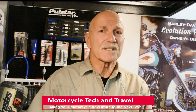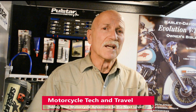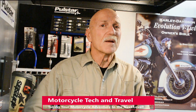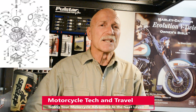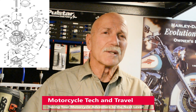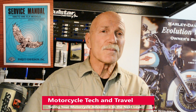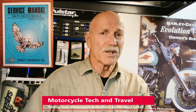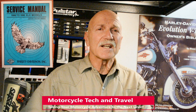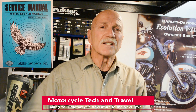Linkert, Tillotson, Bendix, and Keihin have supplied carburetors to the motor company. Having worked with complex automotive carburetors like the Rochester Quadrajet and Japanese hybrid emissions carburetors packed with solenoids, the Sportster carburetors are easy to service and rebuild. For troubleshooting, rebuilding, or adjusting specifications, I use the Harley-Davidson service manual covering the Sportster model year. I have the 1986 to 1990 factory manual in my library, and Keihin offers online details as well.